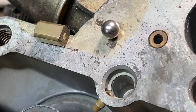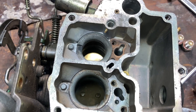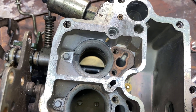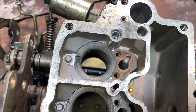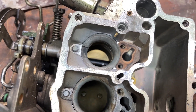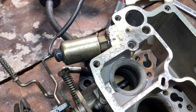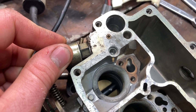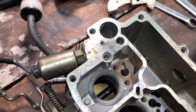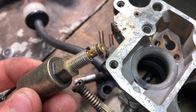I've just gone ahead and removed the ball and the weight from the accelerator pump — that's what you'll find inside of it. Here we've removed the two emulsion tubes, and as you can see there's a bunch of old gaskets still stuck down there, so we need to scrape that off and make up a new gasket. Next we want to remove this solenoid here — just put a 12mm wrench on there and unwind that from the carburetor. We want to make sure that the O-ring on the end is okay and that it clicks when you put 12 volts on it.